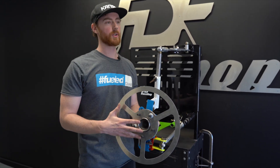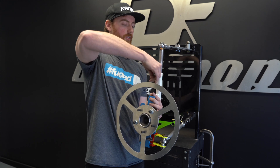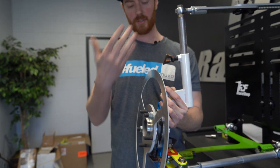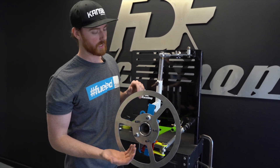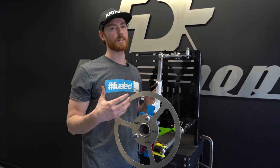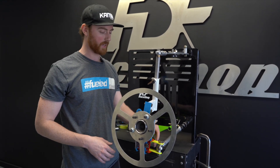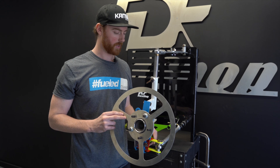That's why I'd suggest ideally you want to reduce the amount of camber gain throughout your suspension's travel range. This is where we start to implement things like trail in the knuckle, where we're allowed to reduce the caster but still maintain a self-steering effect. In closing for camber, when we're discussing grip driving we could go on for hours — in this jig we would focus on the fact that under compression, camber is actually gained. Going around a corner in grip driving, as the suspension compresses, you want to be gaining camber to counteract the slip angle of the tire — so while the body rolls, you're increasing the contact patch of the tire and the level of grip it can provide.